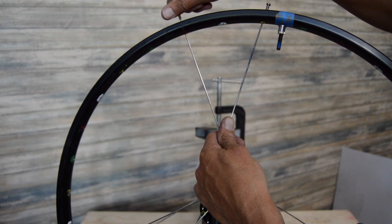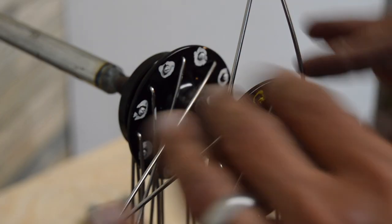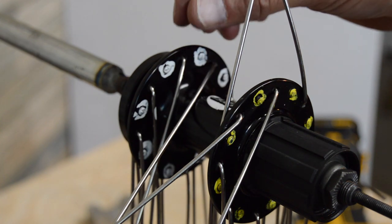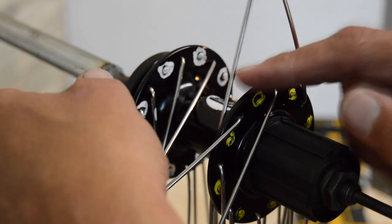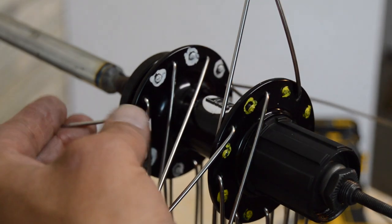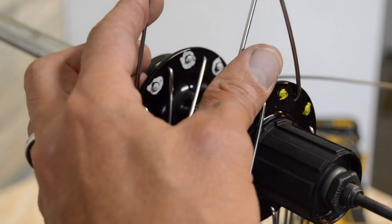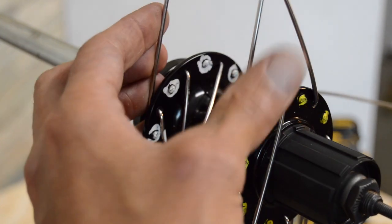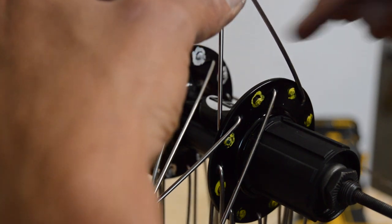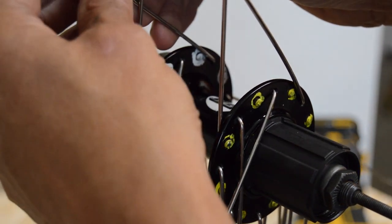And we're ready to move into our second pair of spokes, which are going to be on the non-drive side, or the left side flange. I think there's a pretty good view to get a good visual on the spokes on the other side. So being asymmetric, this was the spoke we dropped in after our key spoke, and it's the one that's clocked slightly behind. So if this is straight up 12 o'clock, this one's going to be about at the 11:55 position. That's going to be our spoke that parallels or is clocked on the rim just beyond our key spoke. And then again, we've got crosswise, we got 1, 2, and then this is our third spoke. Again, we're going to go up over and under like so.